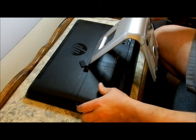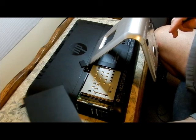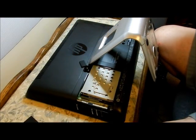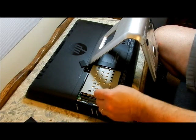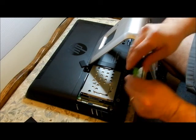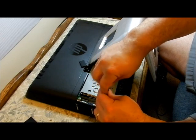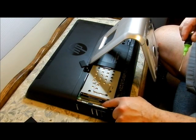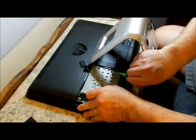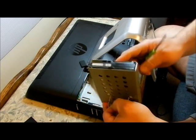I don't even like putting it on a table — I like a nice pillow-type cushion. You just slide this back and it comes off very easily. Just remember you've got to put this back in because the screws don't go through there. I have the screw set aside. This is a handle just like on my HP 300 — the same kind of handle, the same kind of spring screw down here. It's a self-retaining screw so it stays with it — it's got a spring. You're going to take this, pull it back; it's plugged in down here. Pull it back and pull it up, and your hard drive's out.